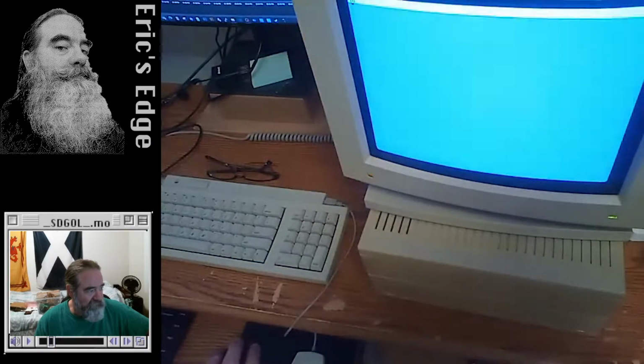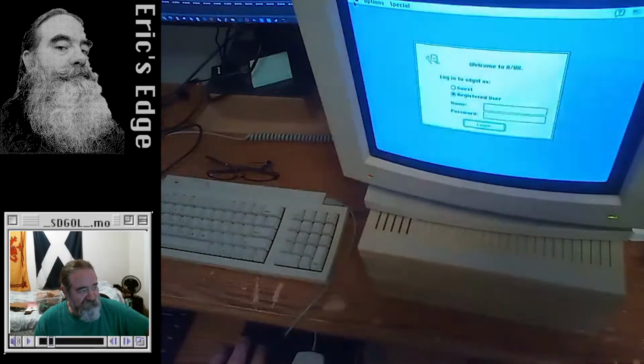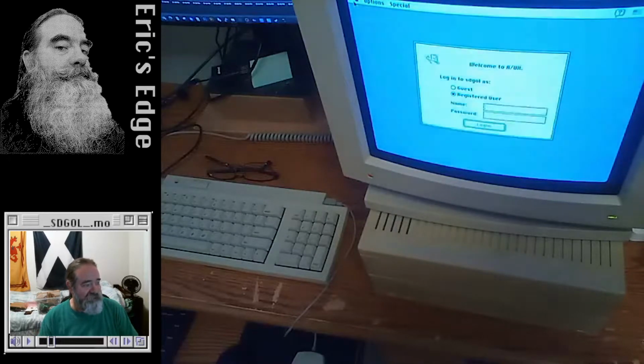Okay. Networking must also be enabled in the etc inittab, and the default route must be set. Here's a relevant portion from my etc inittab. Wait for networking, respawn for networking. So you can run the syslog daemon. You need to set default route. Okay.